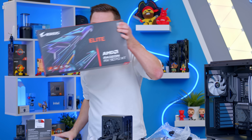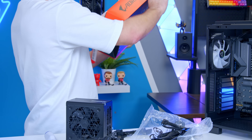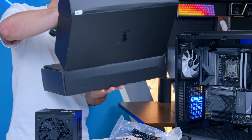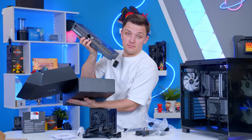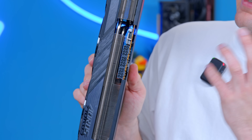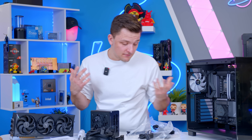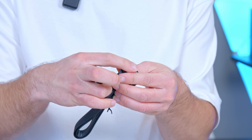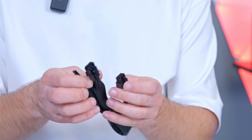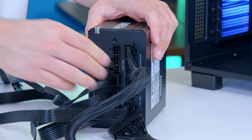I need to unbox the GPU to figure out whether, like some of the Sapphire cards on the 9070 XT SKU, it uses the new high-power cable or the older 6-plus-2 pins. It's a beautiful card, by the way. And this uses the older 6-plus-2 pins. Ultimately it's still the right card for the job, but I would have rather had the high-power Gen 5 cable. The power supply does have the cables needed — there's a single 6-plus-2 pin cable and a double 6-plus-2 pin cable with one input and two output connectors, so you are literally using all the GPU power cables provided.